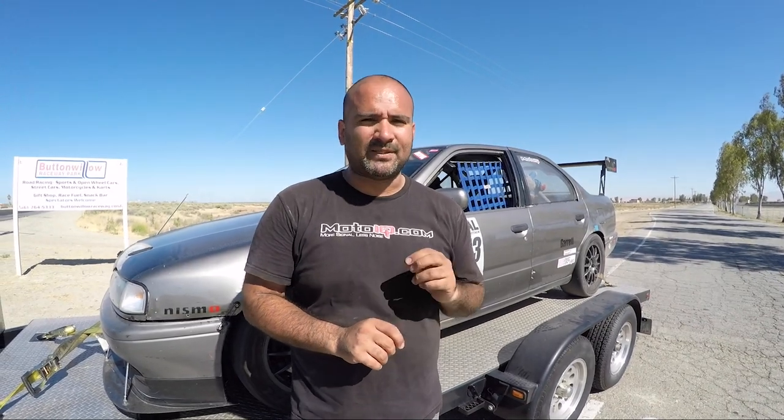There were a couple times that we had a little bit of piston knockback, and specifically that was exiting the bus stop. So after the hard left-hander entering the bus stop, when you're about to tap the brakes before exiting the bus stop, which technically I guess you're supposed to go flat out, but I'm still pussyfooting a little bit through there. When I do tap the brakes there, there is a little bit of a long pedal the first time, but on a second pump, everything's back. Nowhere else did I feel the piston knockback issue, so I'm confident that it's fixed.